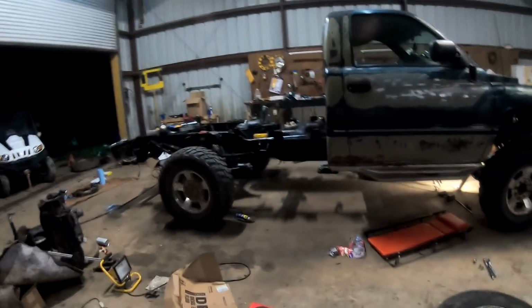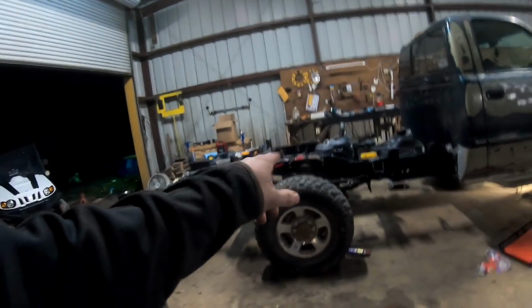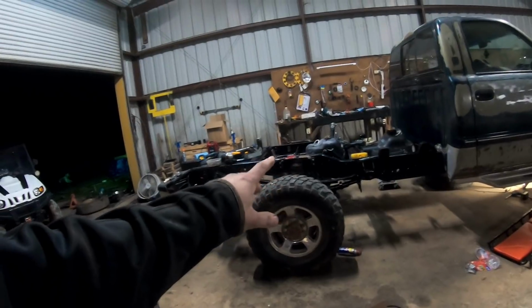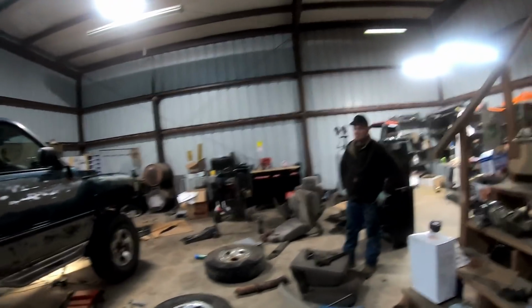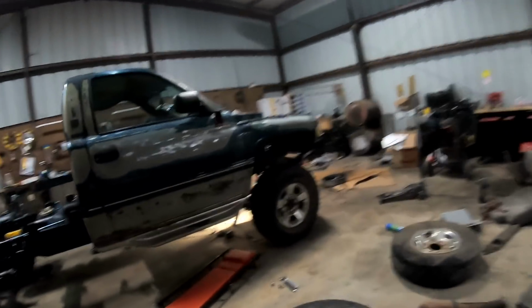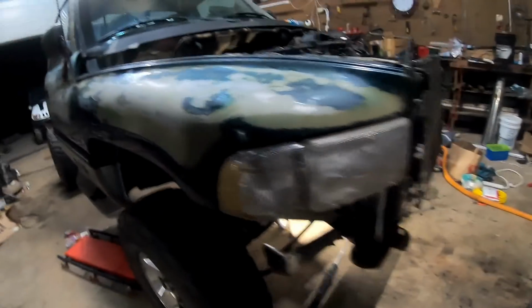Tonka truck engaged. Yeah, definitely glad we measured the back with 55 psi in the bags and lifted it 1.5 inches. So as far as level, with a 2-inch leveling kit on the front, should be close. I don't have the steering hooked up, so I don't know where that's going to land for turning.